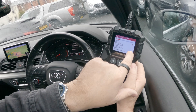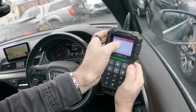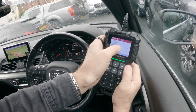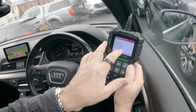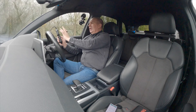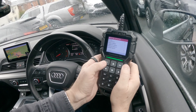So go to Diagnose — you'll notice it switches on straight away. The other one has to recognize the car first; this you just plug in, click OK, and it goes through the system. It identifies the correct protocol — MIL status: off. Trouble codes in the ECU: zero.